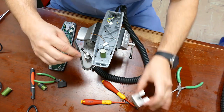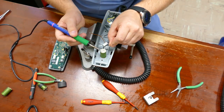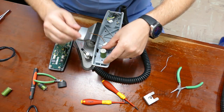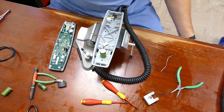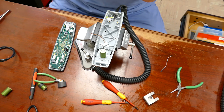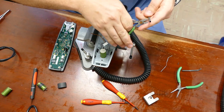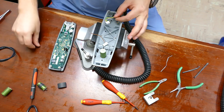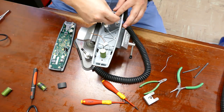I create just a little curl there and then cut it off. I'm going to use the holes where the clip used to go through to hold my capacitor while I tin it. Now that side that has the curly Q is going to connect to this wire that's really soft and bendable down here. First I'm going to give it a little bit of heat shrink — I'll use some 3/16 heat shrink. Flip off just enough and put that over the flexible wire.